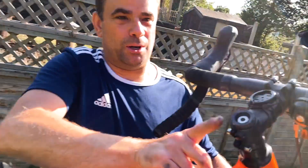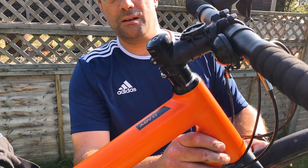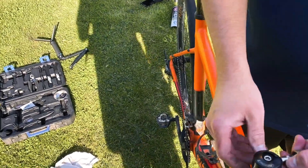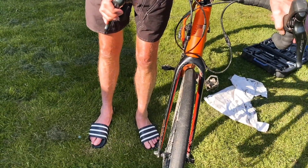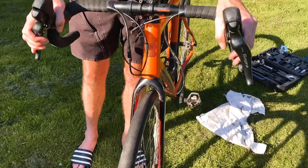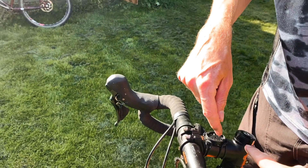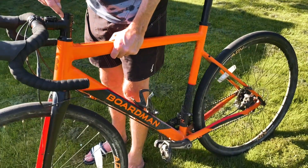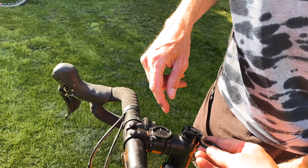What we're doing is pulling the plug out — that one's got too much space. There you go, there's no play — it's just gone, that's what I mean. That's really good, I'm impressed. At least you can use it now. So with the addition of just one more spacer we've managed to resolve the issue of my headset creaking and knocking. Thanks for watching, and please put in the comments if you've had similar experiences, particularly if you own a Boardman.